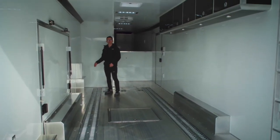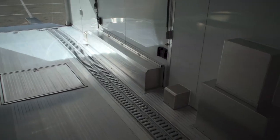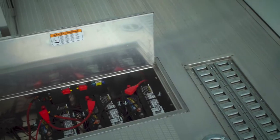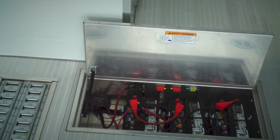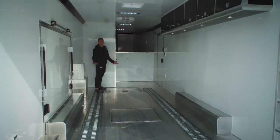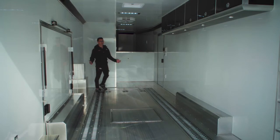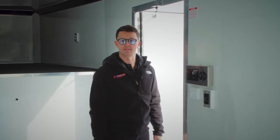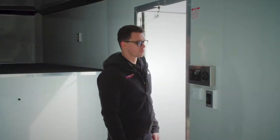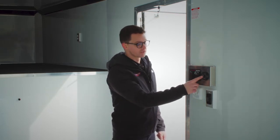You're probably wondering what all these boxes are in here. If you remember, we looked at all those different features on the outside — your fuel station and all of that. That does take up some space on the inside, but it's not past the fender so it doesn't intrude with the car at all. Here is the battery bank I mentioned earlier. These three AGM batteries are in here to help power all your 12-volt systems and keep your generator firing up. More batteries is really better — once one goes you've got another and another. There's a trickle charge from your vehicle, and if you're going on a long trip to the track, that Onan commercial-grade generator's control panel is here inside the body of the trailer. It's fully ventilated and ready — you can prime and start the generator here and monitor your fuel.